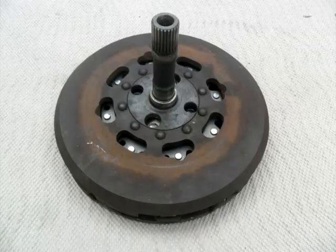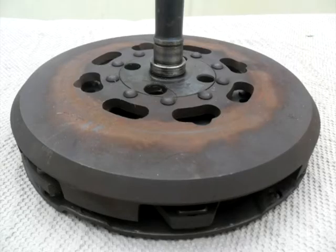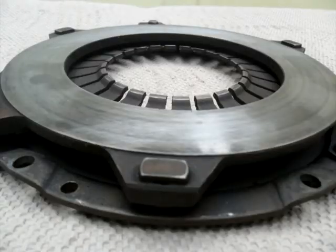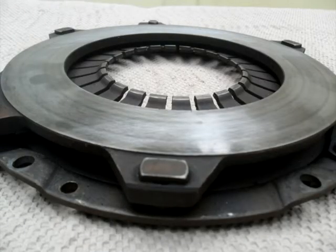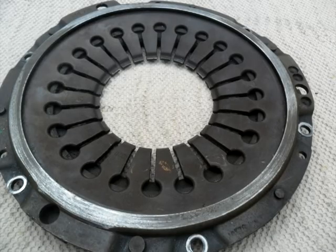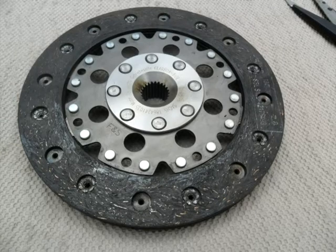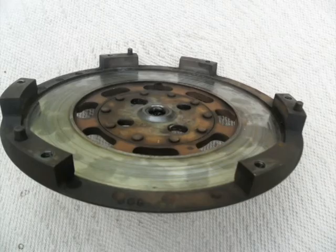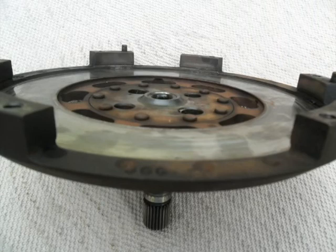I'm frustrated with this car. Go and tell the guy it doesn't declutch — that means it releases the pressure plate over the clutch disc. It doesn't do it. It separates, but not enough. And the disc is not bent. If somebody says it might be the condition where the clutch plate is bent, and it's all the time rubbing against the flywheel — that'll do it too.